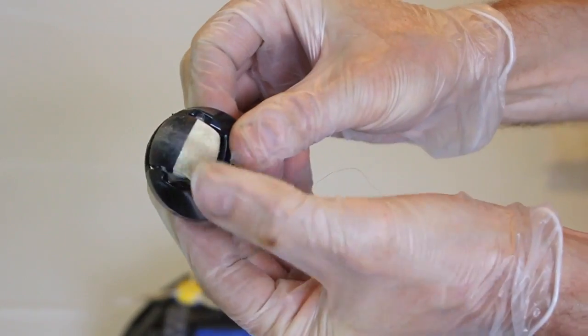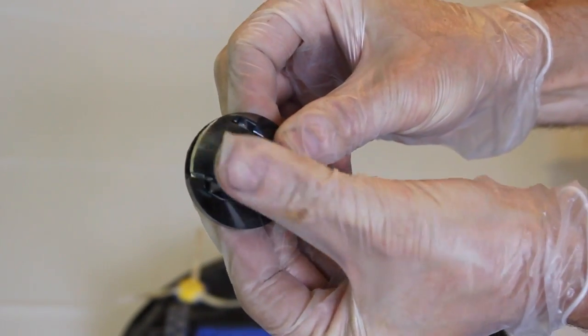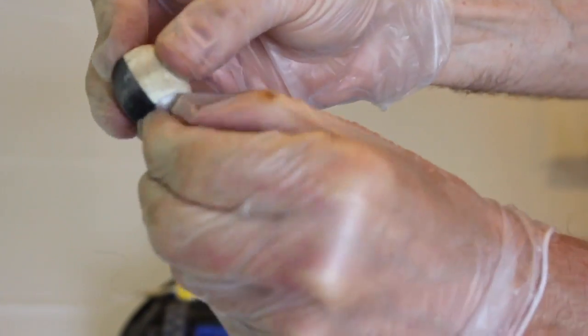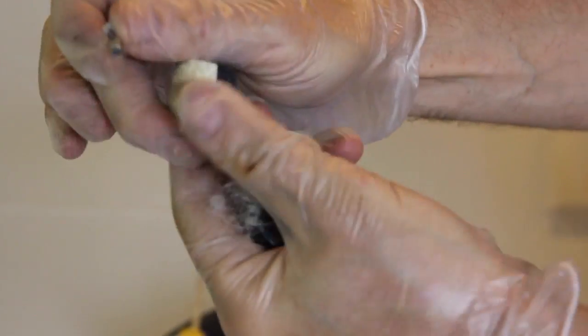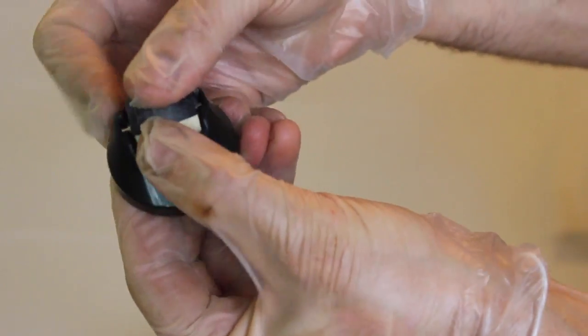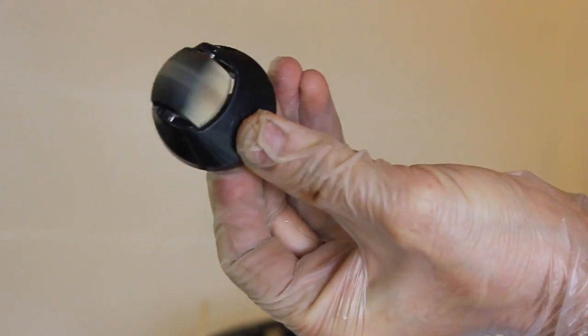The front wheel may be slightly jammed and won't spin correctly. This can be cleaned off by taking the wheel out and removing any hair that's caught along the axle. The axle pops out, so all the hair can be easily removed. Place the wheel back in and check that it can spin freely.